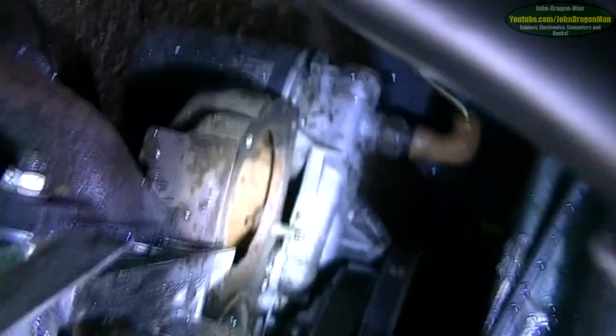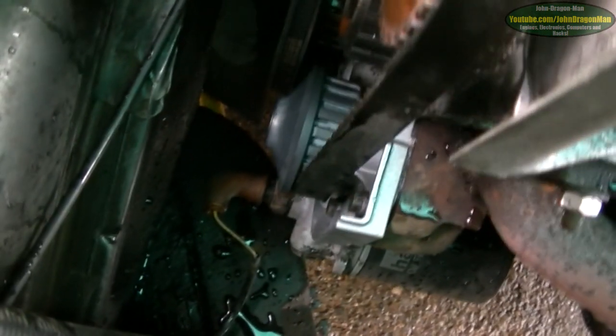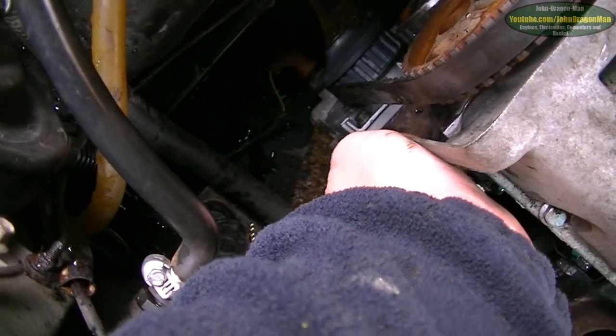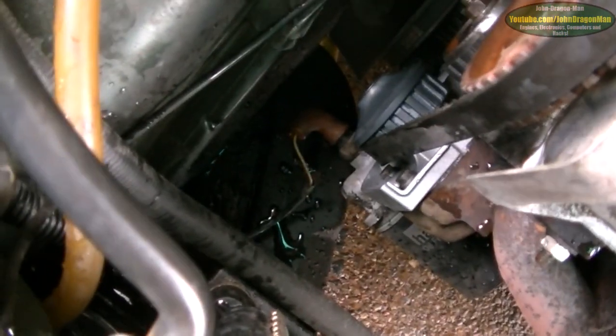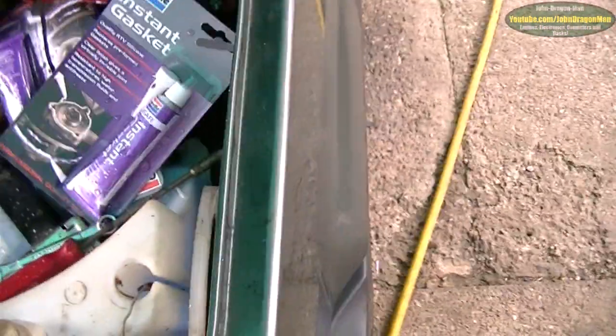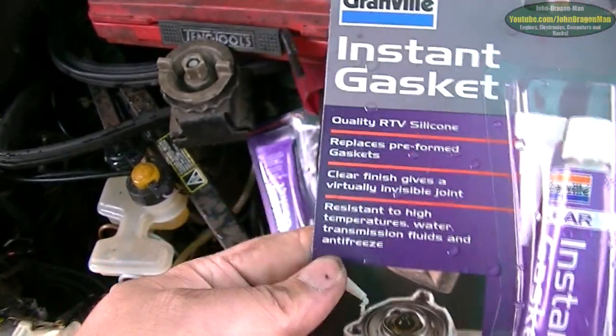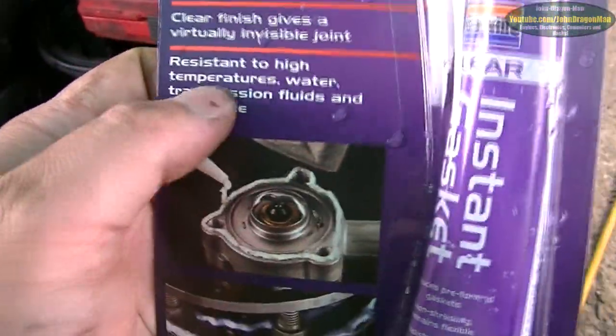The new water pump is on. A couple of tips: don't forget to clean the surface that the water pump mounts to — nice and clean, make sure there's no remaining sealant around there. If you're going to use a sealant, don't use standard silicone sealant that you'd use to seal your bathroom — you have to use proper instant gasket or similar, the blue stuff. You've got to make sure it's temperature resistant, because some bathroom sealant is not temperature resistant. Just be careful when you're putting it back on and try not to knock anything too much.